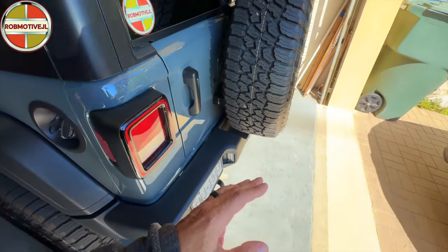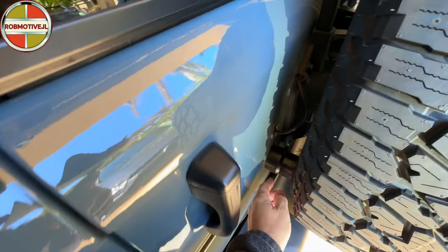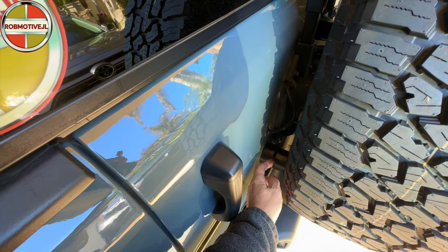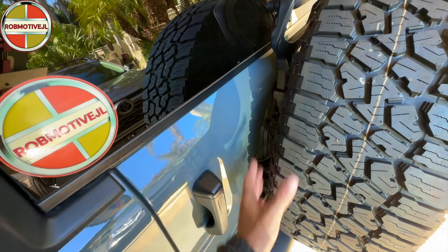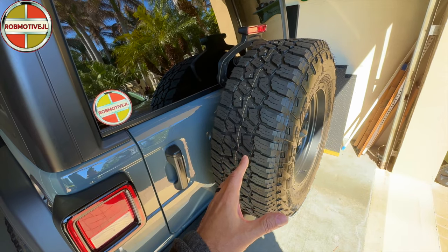Moving around to the back, we had to go ahead and put the spare tire on the same size as the others. That's something you may not necessarily have to do if you decide to go with a cover — if it's pretty much the same size as what you've put on the Jeep, it'll be hidden anyway, and it'll still get you out of a pinch. I also put on these bumpers because the larger tire was pushed out and wouldn't contact the stock bumpers. You want that to tie everything together so you're not putting all the downforce weight on the holder. This tire is just a pound or two above the recommended weight — I think it's just fine.